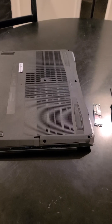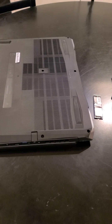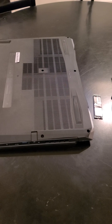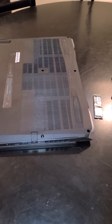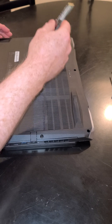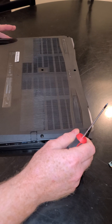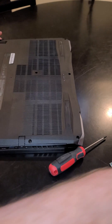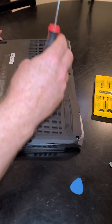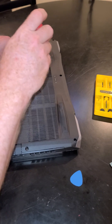In this video we are going to upgrade our Acer Nitro 17. It's a little dark in here — hopefully that helps. So what do we need for this upgrade? We're going to need an additional drive — this is an NVMe M.2, Gen 3 or Gen 4, whatever floats your boat. You will need an electronic screwdriver, maybe a number zero Phillips, and a guitar pick, which is going to be needed to wedge this open.